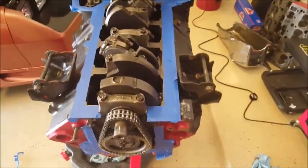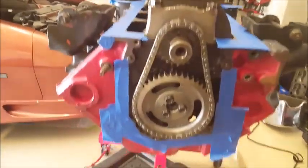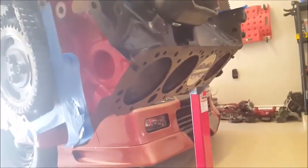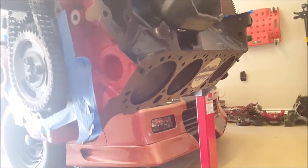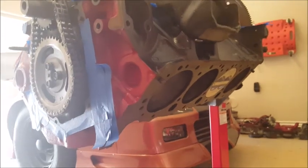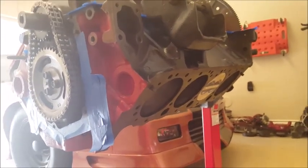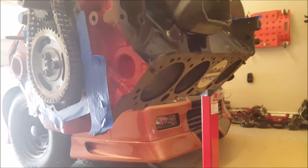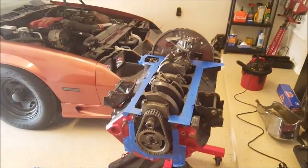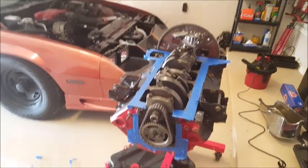You're just going to do that around the entire engine where you don't want paint. I still have to finish taping off the front for the timing chain cover and down on the pistons as well — just a nice one or two strips of tape and then use newspaper to cover the majority. That's it — after this I'll show you guys the process of painting it.